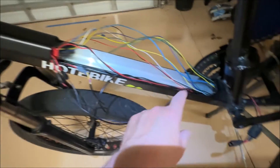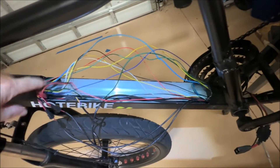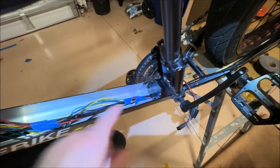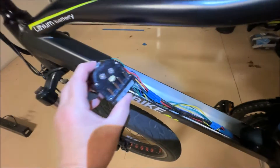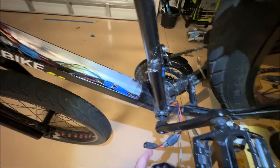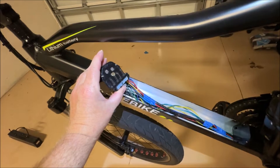With everything hooked up, you have a lot of wires to work with. You've got to tuck as much of this wire down in this direction and up in here, because there's a lot of space in the top part to get them tucked away so we can put the end caps on and slip the battery in. With the bottom plate on, all these wires have to be tucked in this channel and then up in here, then this plate goes on. You can see the battery terminals there, but on this bike those terminals are not used — the battery hooks up to a pigtail down here, so they're dead.